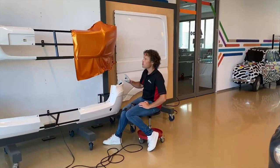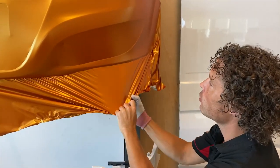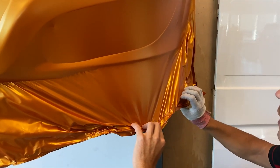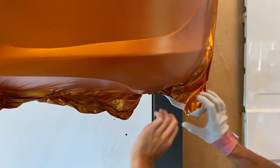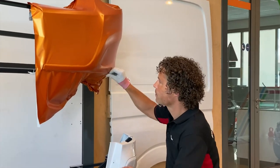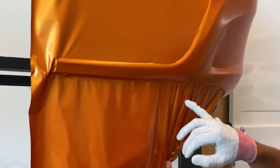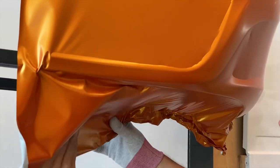We've now reached a point where we will have more tension. First we will remove the tension using heat. To avoid a color break, we will lift the film up as far back as to this light line in the bumper — try to do this as smoothly as possible and in a nice straight line. Then we'll heat up the film. Be careful not to overheat the film, otherwise you could still get a color difference or adhesive break lines. I thoroughly heat up the film where there is the most tension. Next I'll wait for the film to cool down again. When it has nearly completely cooled, you stretch the film over the curved surface. I've heated up the film quite hot, almost to the level required for post heating. Make sure you let the film cool down, at which point you can apply the film further. If you have some discoloration, it will almost not be visible because of the light line.